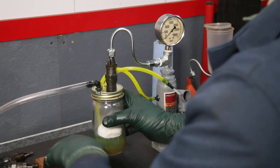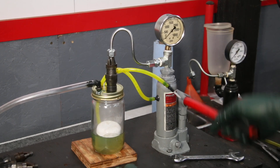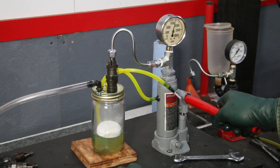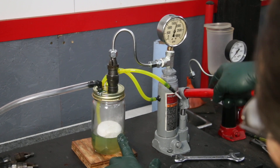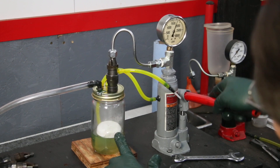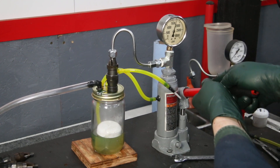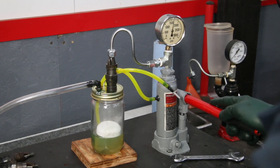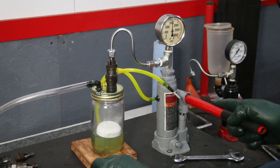Here comes number five. 1,500 — oh, look at that. This one's pretty bad; look at it squirting, it's literally squirting and it's not chirping at all. I'm bringing it up to about 1,800 and it's leaking down very badly. I'll leave this one on and we'll take a look at a couple of these and discuss some of the results.